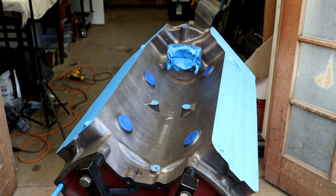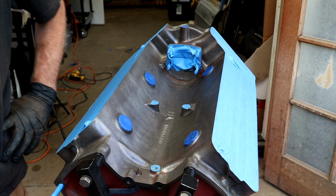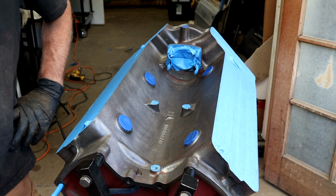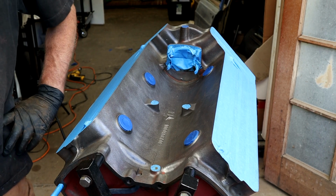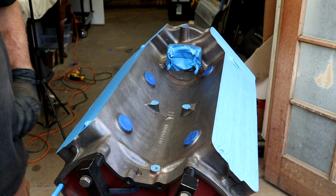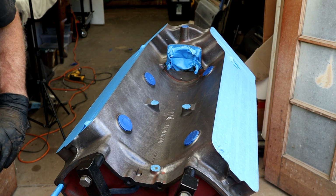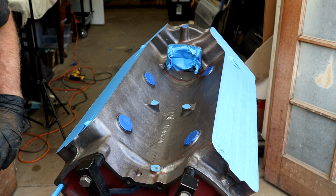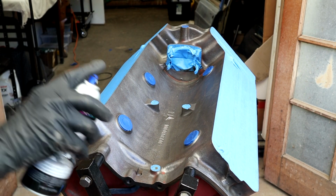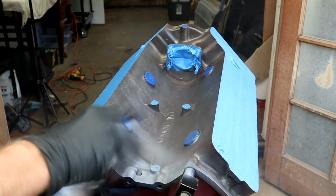Okay, a couple of light coats and then one medium coat, all within an hour of each other. So there is a recoat window, so it's chemically bonding to each subsequent coat, and then the top coats need to go on within an hour of the last coat. So it all makes pretty good sense. It allows flash time, but also leaves it open, ready, so it chemically bonds to each next coat. That's pretty good. So a nice light coat. Not trying to get full coverage.